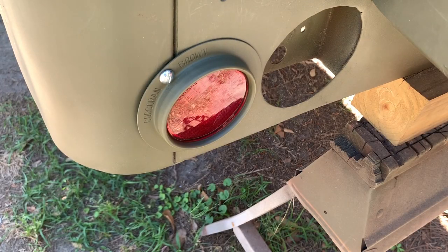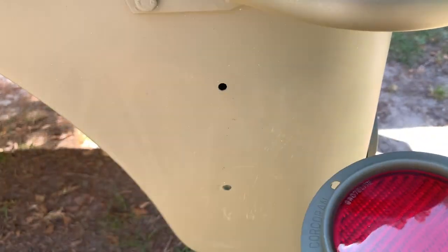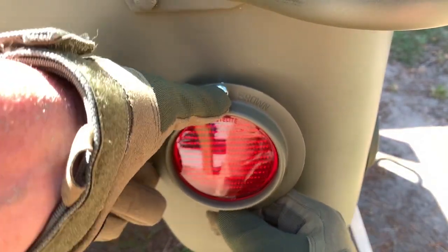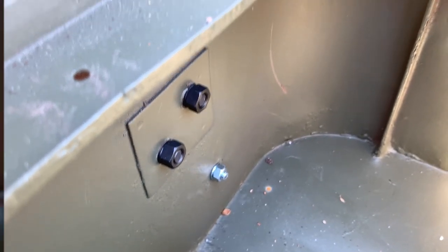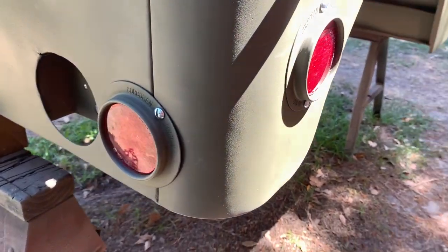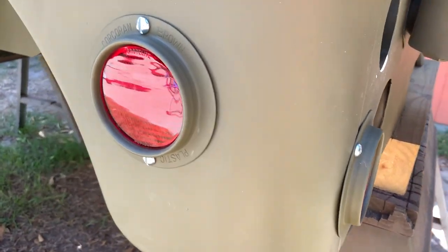It's got slots that will fit the slots on the machine screws and bolts so you don't scratch up or damage the threads — just a pet peeve of mine. Next, we'll go to the outside reflector on the side of the Jeep. This is the driver's side. Both measurements are the same on the passenger's and driver's side — you just have to mirror them when you do the opposite side on the passenger's side. I'm going to put the manufacturer's label to the top, insert the two bolts, fasten through those two holes, then reach through the back side of the fender well and install the lock washers and the nuts. The top one for the outside is inside the toolbox; the two for the back go on the outside of that mounting bracket where the bracket goes to your frame, and the other one for the outside is right there behind your fender well. I just use the screwdriver to hold the outside and then use the ratchet to tighten those down. I've got my screws' heads clocked — I just think it looks nice.